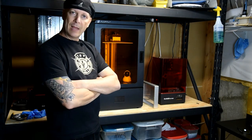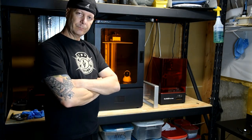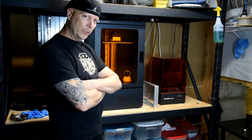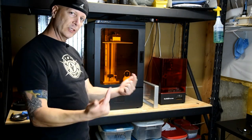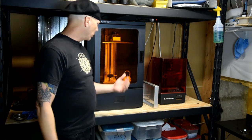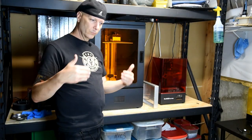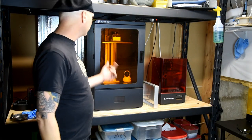I'm pretty happy with the gaffer's tape. I tried sliding my vat right in there. I didn't have any issues with it. One thing you want to make sure though, inside there's 2 screws that kind of stick out. At first I had the tape over it, going beyond it. So you want to make sure that you don't, because I believe those work as stops so that the vat doesn't go back too far. That's one thing you want to do.